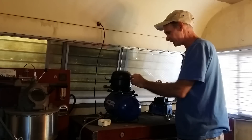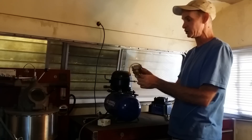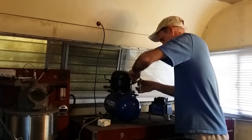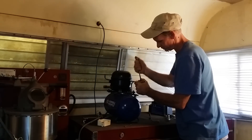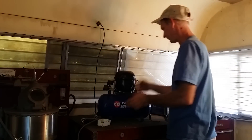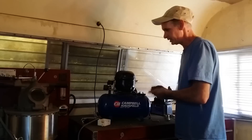I'm going to use this pipe that's already here and use a compression fitting on there, right like that. I've already made a new line because this one had a hole in it — it's almost the same shape, but I had a hole so we'll use the new one. Get the air dryer on there. I want to put this filter in before I get to the tank, otherwise all the oil from here may get pushed into my tank. So I put it before the tank. Now all we need to do is hook up the electrical.